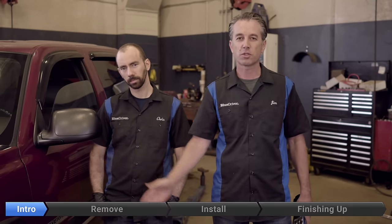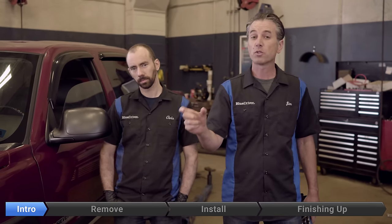You're not going to get a check engine light for this one — it's actually a trouble code. If you have a C0327, we know that you have a BlueDriver because only a BlueDriver can read this code. It's not related to your emissions; it controls your four-wheel drive. In your message display center you may see it say 'service four-wheel drive,' or your four-wheel drive light will come on, or your four-wheel drive will not work at all. You don't have to have a scan tool to see this, but you'll definitely see a C0327 on this one.